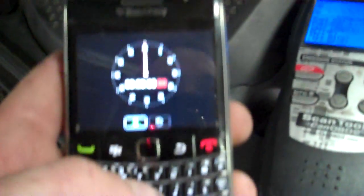Considering it's got a built motor and a supercharger, it runs pretty dang warm. Let's see if we can get these fans to turn back on. We're at 203 again, and fans should be turning on in a second. My camera is about to die — that's always fun. 204. 206. Come on, fans. Stopwatch ready. And 208, we're almost there. There's the fans.